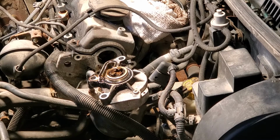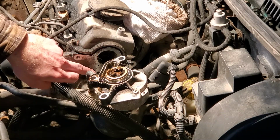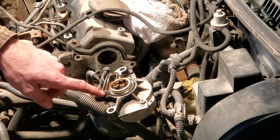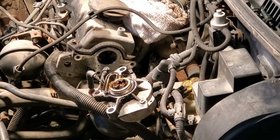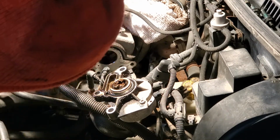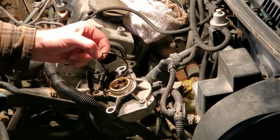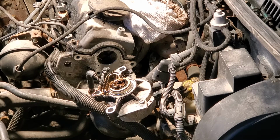So you can't do too much blowing because it just causes more oil to come out of the passageways. A little tiny passageway, you probably can't see through the pump. A little tiny passageway down here, which coincides with that hole in the O-ring there. And then there's a bigger passage down there, which is this opening here. So, not a whole lot more I can do with that, other than hope that the new O-ring will seal. Should, because usually what happens is the old one just gets compressed and dried out over time, which it's pretty stiff. Doesn't look very flat, but we'll put the new one in nevertheless and see if that solves the problem.